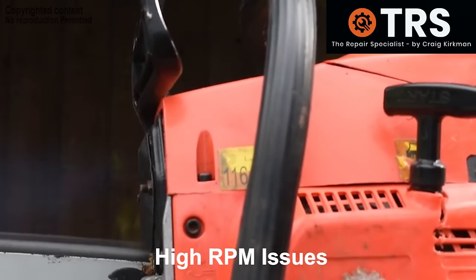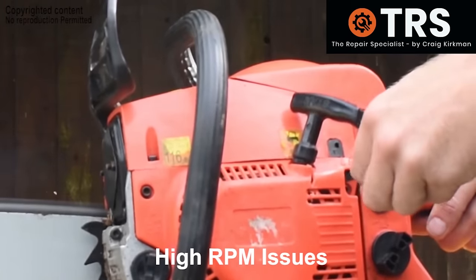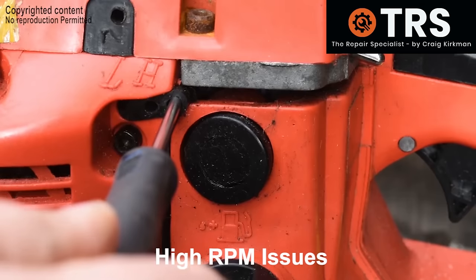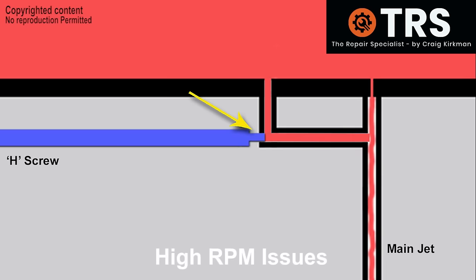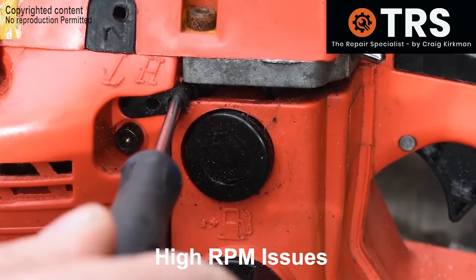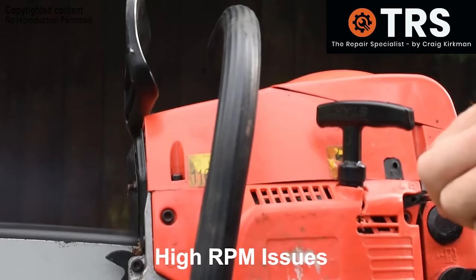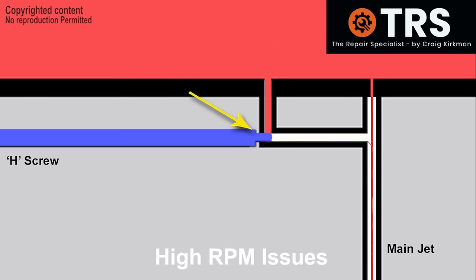In this scenario, each time we press the throttle, the engine's running lumpy and there's quite a lot of smoke emitting from the exhaust. In terms of mixture screw settings, the problem here is over-adjustment in the opposite direction — meaning the screw is screwed out too far. If it's over-adjusted out too far, then it's going to allow too much fuel down there, creating too much of a fuel-rich fuel-to-air ratio. So this time the engine's bogging due to too much fuel — more than it's capable of combusting.